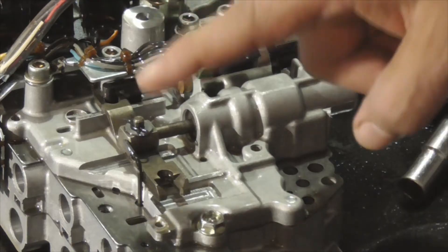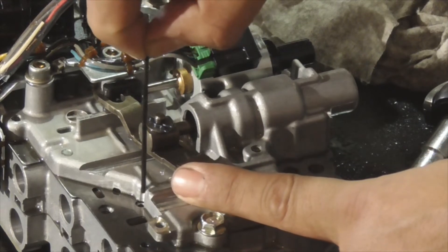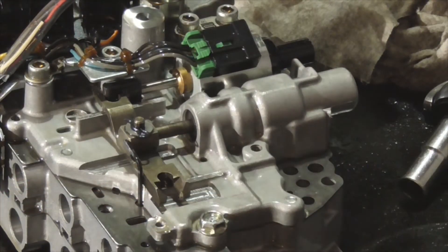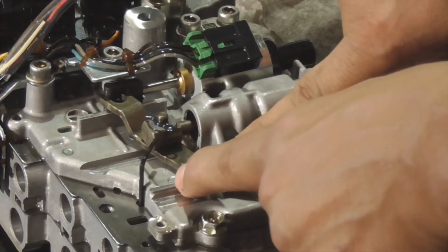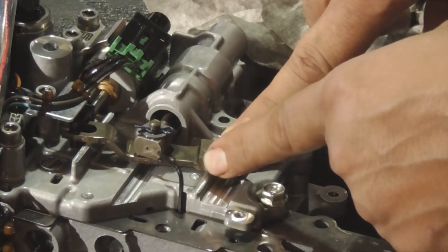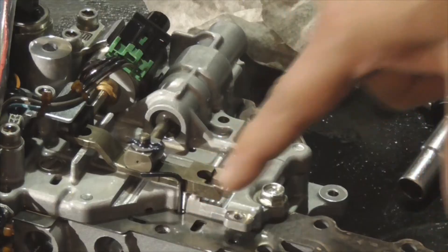There is a hole here with a channel — this is the hole that you are supposed to use to lock it in that position. This allows it to move much more freely — it can pivot a lot more. It's locked in this position, it pivots right here, but it allows this to move all this length right here. When it was sitting about right there, you can see it's kept in and not allowed to go all the way out, and that gave me a P1778 code. It's real important that you remember to use this little tiny hole — you can see it's got an indentation, a groove, a channel. This little Allen wrench is going to go from underneath. Do not use the other hole — that hole is the wrong one and you will get a P1778 code. The hole does go all the way through.